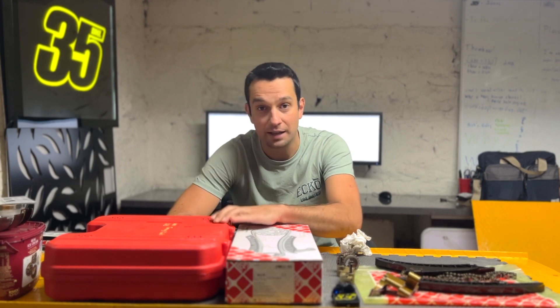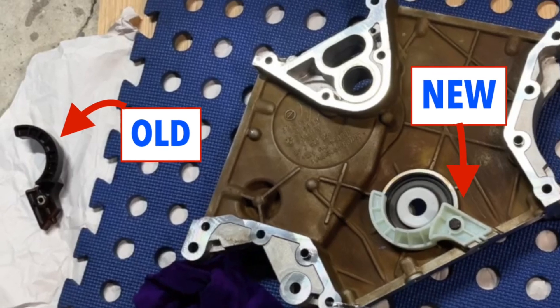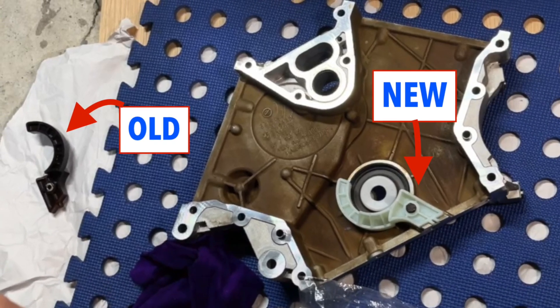I bought timing tool kits from eBay so you can save a little bit of money as well. Now first, the timing chain: if you are rebuilding your engine, make sure you buy all new chain guides and tensioners. I also recommend buying the lower sprocket — which is the crankshaft sprockets — and the lower guide as well, the one that sits right behind the main seal. They are made of plastic, they crack and they tend to fail. It's probably about $42 for the sprocket and about $40 for the guides — it's a good idea to replace those.